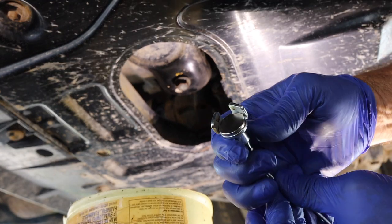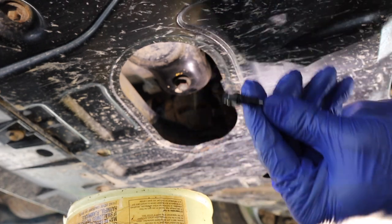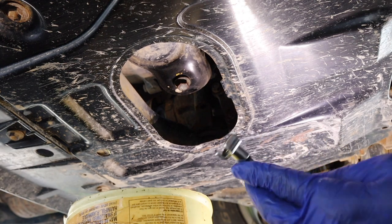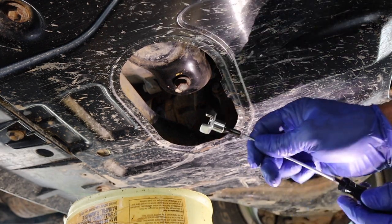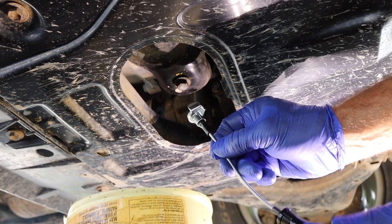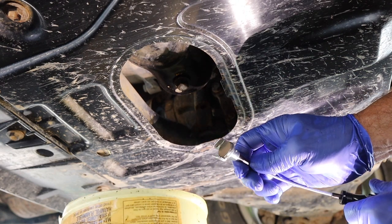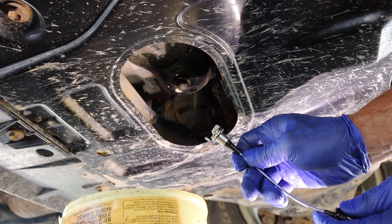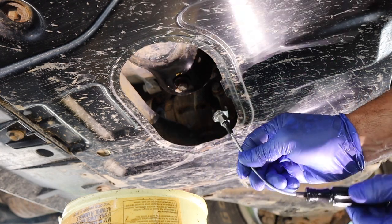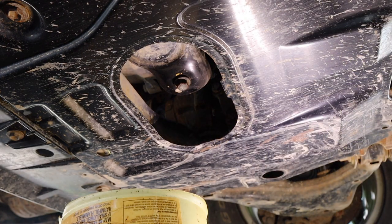It's just a small flexible thing. It's got a magnet on this end that pops off and uses a quarter inch drive — I'm going to talk about that when we're inside. What this thing does is you loosen up the drain plug, slap it on, and then you can turn it just the last mile in order to pop the drain plug out. It keeps it from dropping into your bowl, your collection container. And if you're draining hot oil, you can easily just unscrew it from a distance so you don't get the oil all over your hands. Let's go ahead and do this.